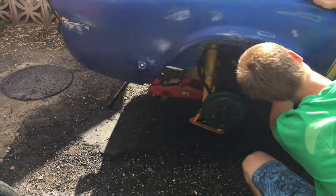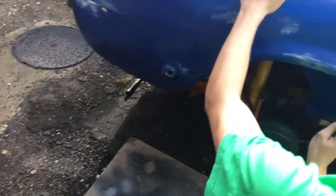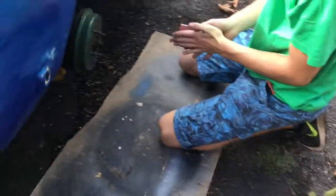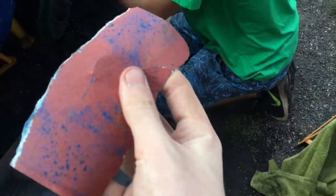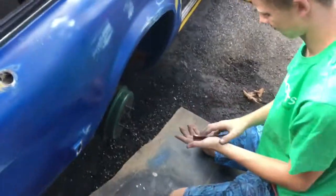Now that you've done all the cleaning, you're going to want to get your friend to try and do some work and stop eating the nuggets. We're just going to rough up all of the inside of the wheel well so that we can get ready to paint it - we're going to primer it first, probably one or two layers, and then paint. We've just gone over this in 180 grit. Inside of that is done now. Obviously 180 is not what you want to spray on, so we're going to go about 400 and just rough it up, moving down the little indents. Once we've done that we're going to prep the paint and then slap some yellow on it.